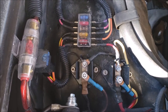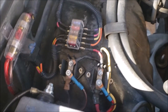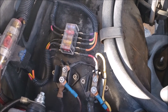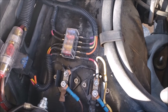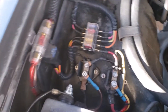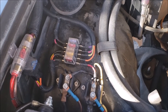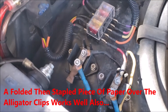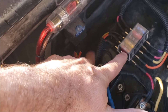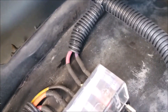That gives you an idea of how I did it. What I recommend if you're new to electronics: have a bunch of jumper wires — I have probably 30, all different lengths and sizes up to 20 feet. Run everything off jumper wires first, put some electrical tape over the alligator clips, make sure everything runs good that way. Then start isolating your wiring — it's tedious when you want to make it look better, but you can see how I loomed it.